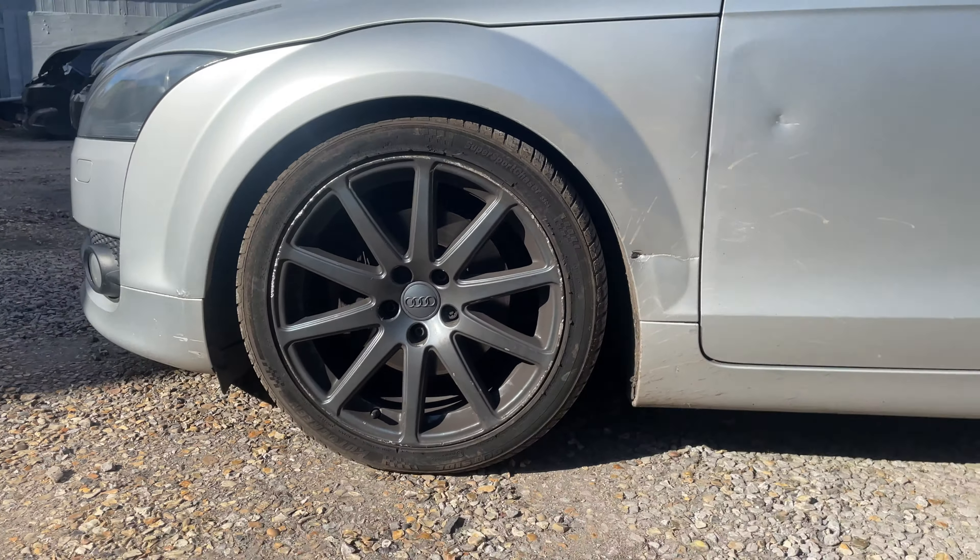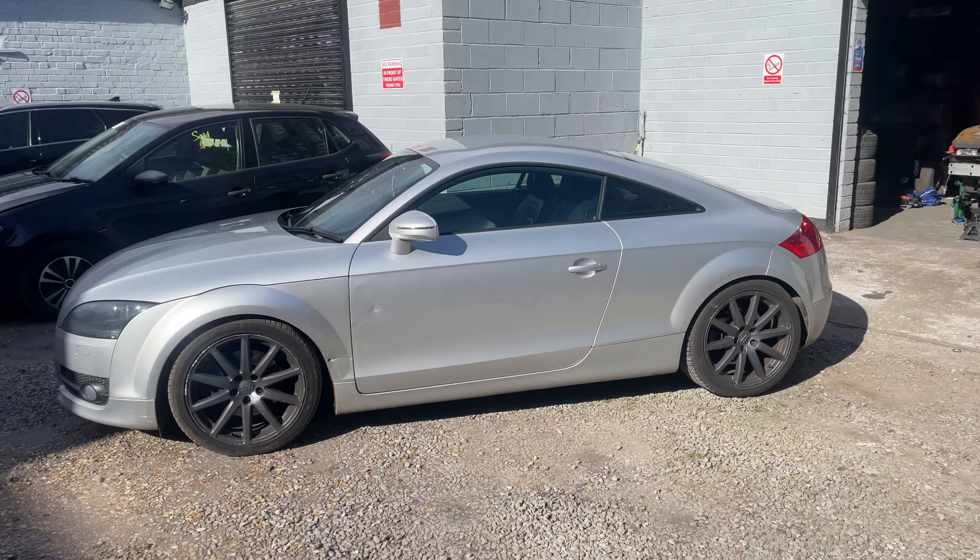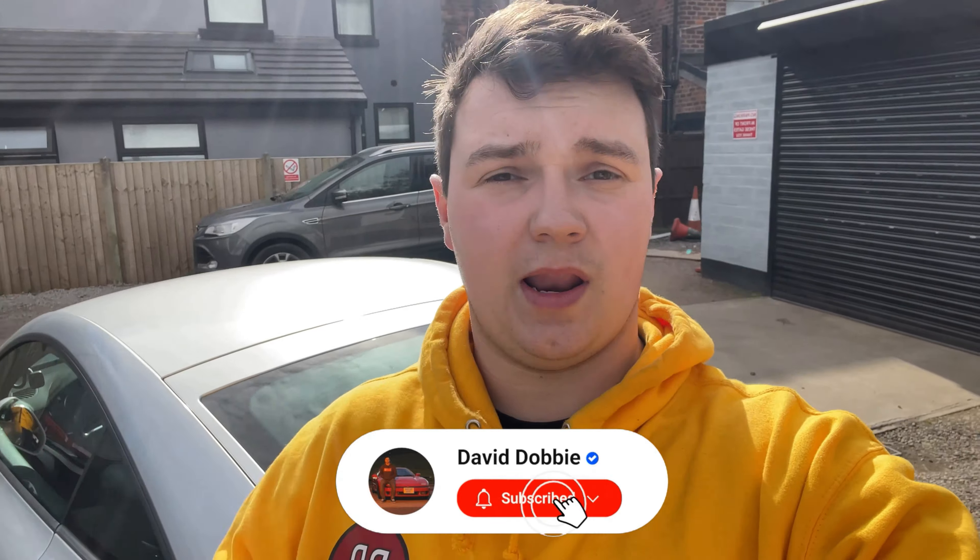The rears have finally settled and the arch gap looks perfect — same for the fronts. It's a good ride height, not too low, and quite usable as a daily. In my opinion the TT looks so much better on the lowering springs. I didn't want to give you a full honest review of the H&R springs just yet though, because when I changed the springs I noticed one of my shocks on the driver's side has completely failed — it's very squashy. So I've ordered new shocks for both front and rear, and I'll post another video with the full honest review once those are fitted.